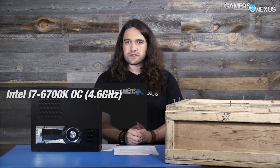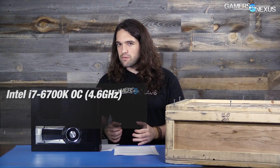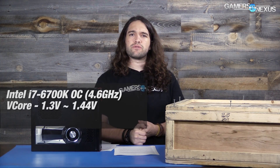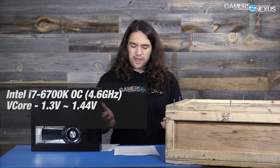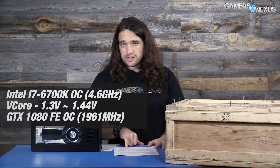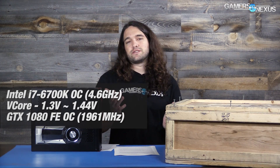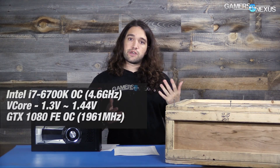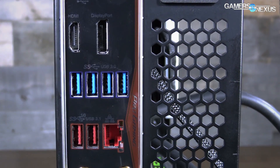The overclock was 4.6 GHz on the CPU — that's a pre-OC. The V-core was maybe a little aggressive at around 1.2–1.3V, but I wouldn't feel bad about it for something pushed out of a factory. The GPU was hitting a frequency of 1961 MHz — also not bad, though unfortunately you can't really sustain that due to thermals. I believe they use EVGA Precision, which is pre-installed and auto-boots on startup. PSU selection is good and they didn't go crazy with any of that stuff.